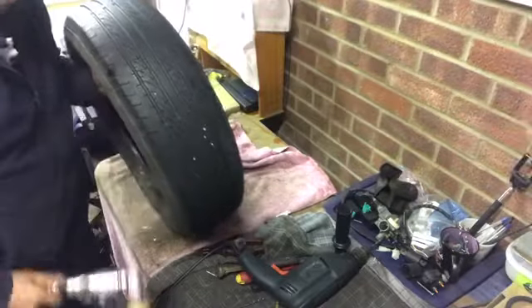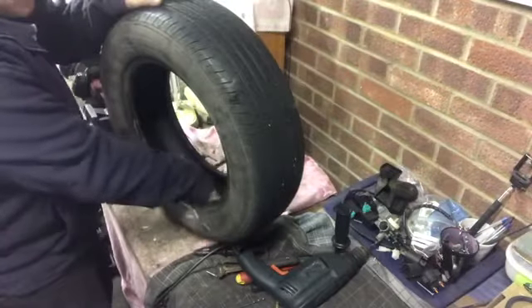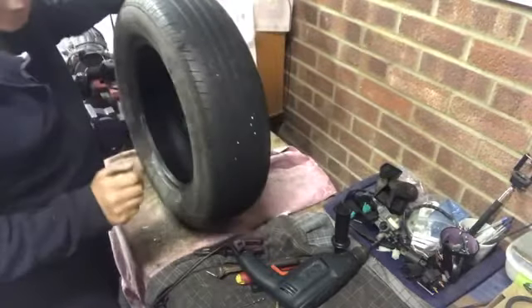Job done — simple as that. Use a bit of sandpaper; it may take a little bit longer, but you definitely need to do this. If there's a ridge from the manufacture of the tire, you will need to rub that down or you will not make a seal.